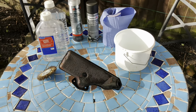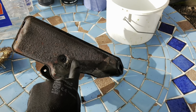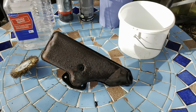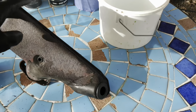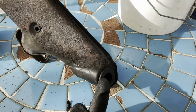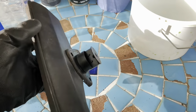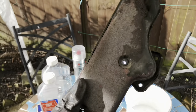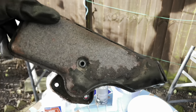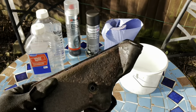Time to recondition the oil separator. These do look quite bad because it gets scorched by the manifold, but I can wire wheel this off and then use some high temperature paint that goes directly onto metal. This little gasket needs to be changed because it gets affected by the heat, and the gasket on the back will be changed too. Because of the job these do, they get full of oil or sludge, so I'm going to run some white spirit through it and keep pouring it out until it runs clear.